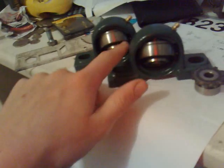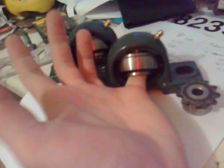So pretty much I've got to put the bearings in the holders. All you do is get a flat head screwdriver, put the holder in the vise, pry it up, and it will just push the bearing in. I'll do that today after school. Like I said, I'll weld this sprocket to the clutch drum today, and then I can mount the bearing blocks when I get home, mount the axle, mount this on the engine, and hook up the chain.